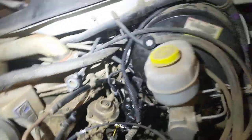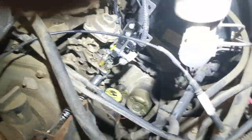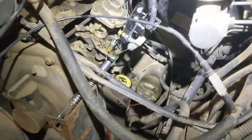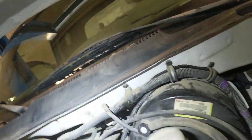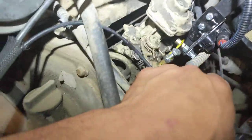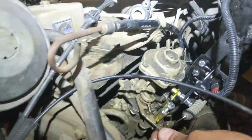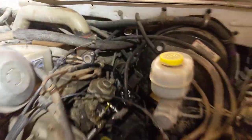This was a bit of a big job because the way the throttle was set up was positioned differently. I still have another thing I need to do later — this transmission has a kickdown cable — so there's the kickdown cable, the throttle, and then the cruise control. But for now I'm going to leave the kickdown disconnected. As you can see, it's just a simple bracket here with the TPS and a piece to operate the throttle, just so the transmission knows the throttle position.